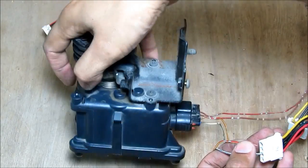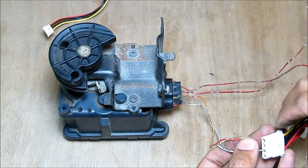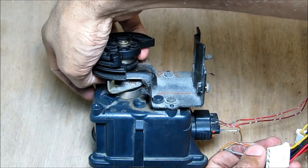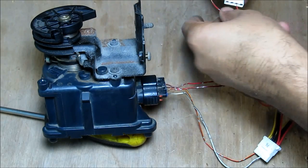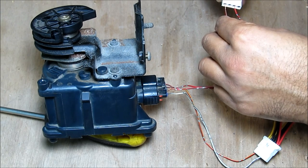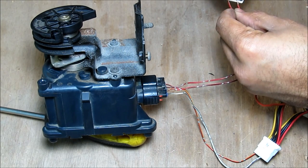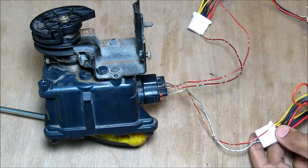As a quick demonstration, the motor is currently unlocked. If I apply 12 volts to these two wires, it locks the solenoid and I can't move it anymore. I can unlock it, move it, and lock it in a different position where it stays locked. These other two wires control the position of the motor — 12 volts moves the actuator in one direction, and negative 12 volts reverses it. If I move it to a random position and release the solenoid, it flips back to the zero position.